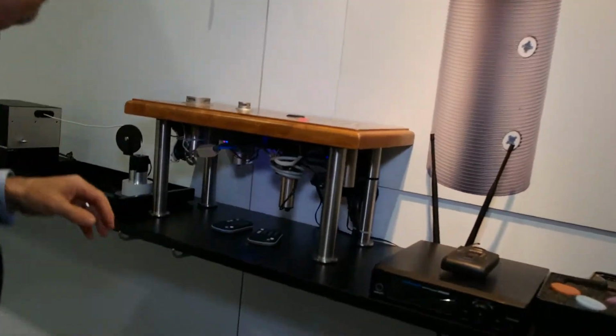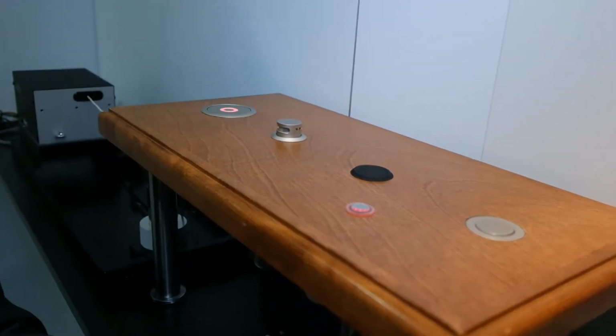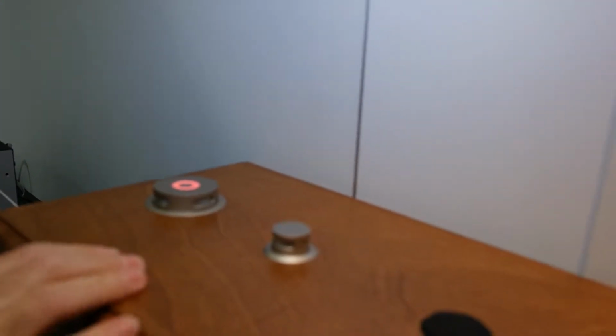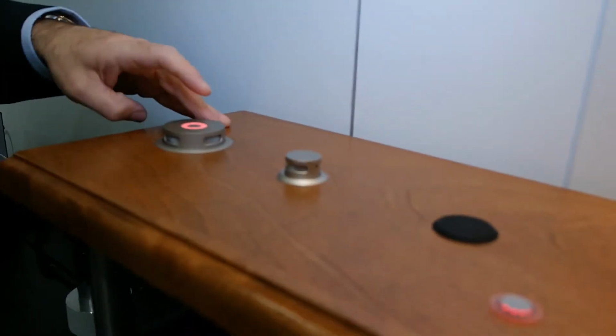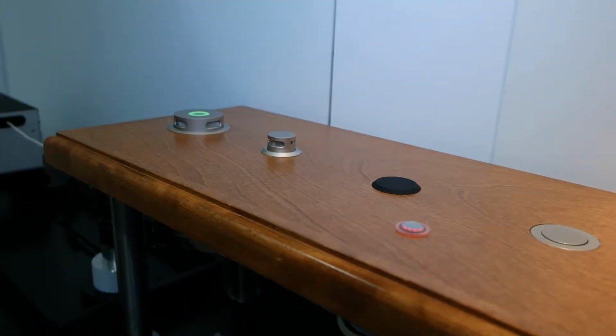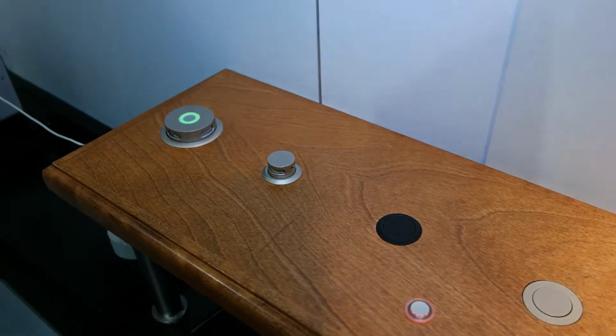The next piece we're going to look at here is a CRM 202. This is again part of the Retracta series. For lack of a better analogy, it's like a CS2. So a dual element, but using the functionality of the Retracta series, so the microphone disappears at the end of your session. And what's interesting too, because we had more real estate to play with, we can put a bicolor ring and a touch-sensitive switch for privacy mute that do send straight to your DSP. And then you can mute the whole room or whatever you decide for that application.